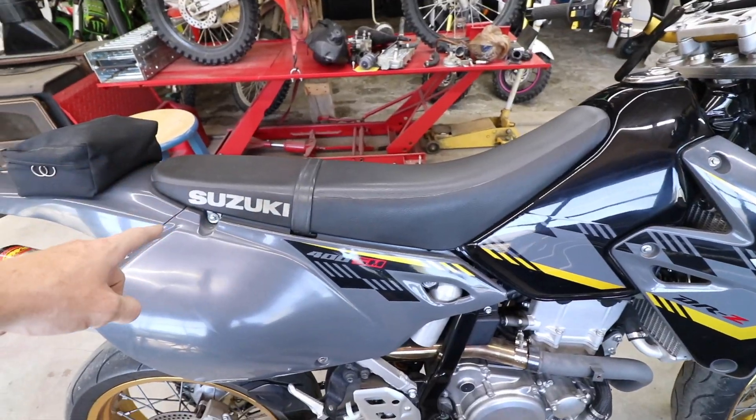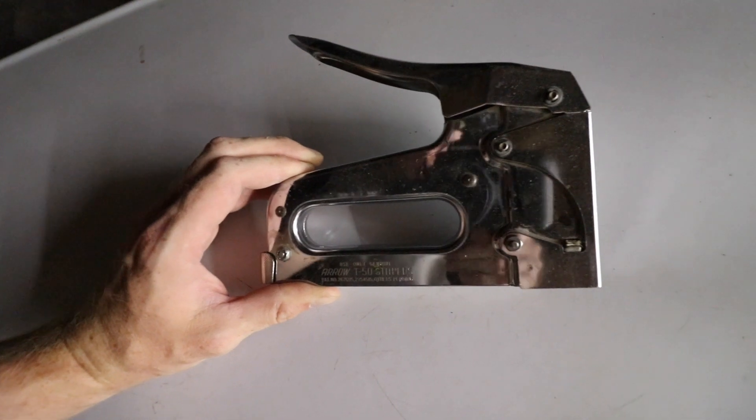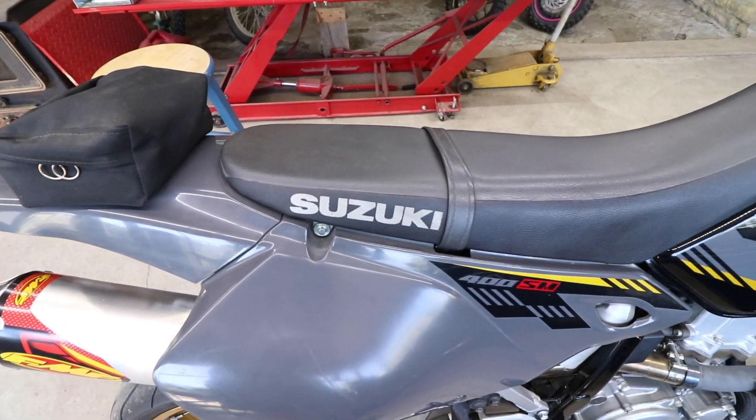Let's hope she fits - oh yeah, that's gonna look good. To install these seat covers there are a couple different methods. The easiest one being a pneumatic staple gun, which I'm going to be using in today's video - it's just so much easier. If you have access to an air compressor, or heck, you can find them so cheap these days, just a small pancake compressor, you might as well have one around. But you can do this by hand - my buddy MJ did it in Tennessee - you can get away with using a hand stapler just fine. We have the compressor so we're going to use it, but if you don't have access to a compressor just use a staple gun - I'll link a cheap one down in the description below.